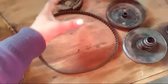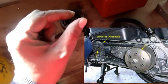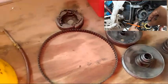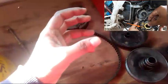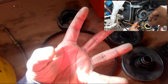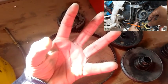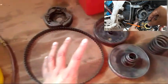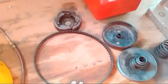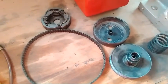The third thing is the variator on the left side. The variator's balls are flat when worn. When we accelerate, the balls press outward — this is the same as the CVT working principle. The power of the ball acts on the engine side. Now, when the ball is broken or worn flat, the vibration issue starts.